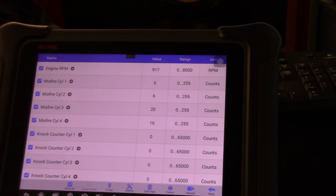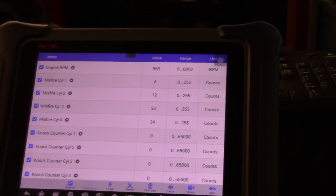But I don't feel anything on the engine. I don't feel any misfires. I mean, if this would be an injector, let's say, leaking a little bit, we would have a rich condition. We would have that showing on the fuel trims. And I can assure you, look, the two are the same. I didn't do anything. I just did that for quick and easy tests.